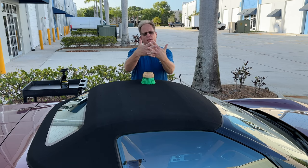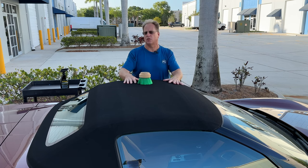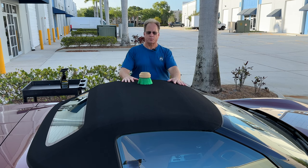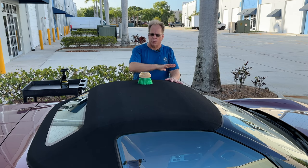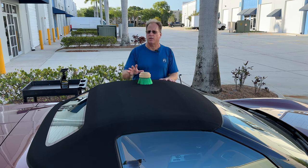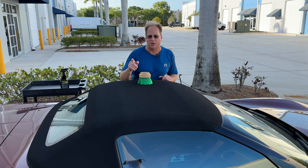There's a weave that makes up canvas convertible tops. You want to get in there and gently agitate it to loosen any dirt that's got into the weave so you can flush it out with water. The first thing I want to do is completely wet this top and let water do what it naturally does. Water is a natural solvent — it dissolves things like dirt.